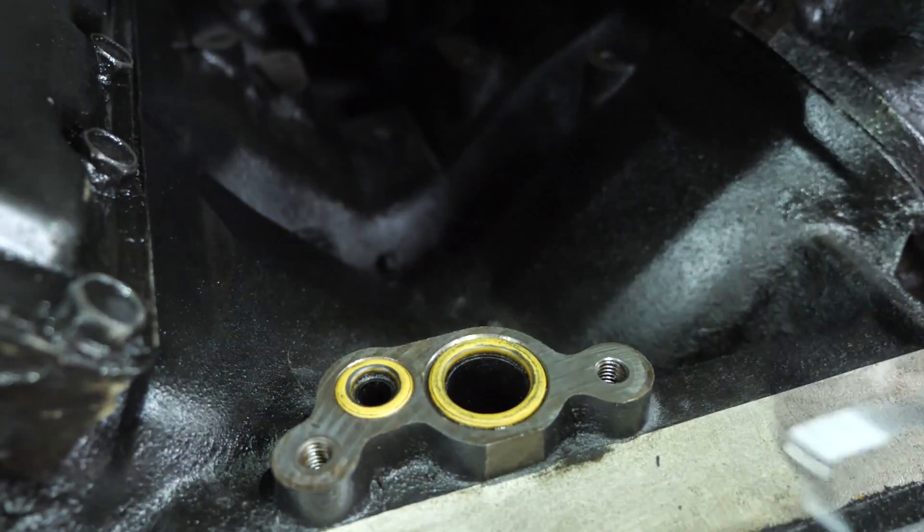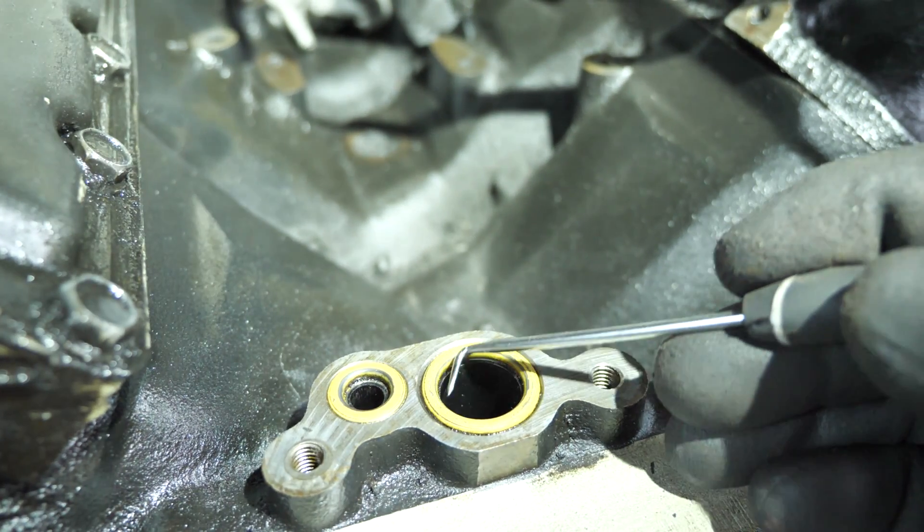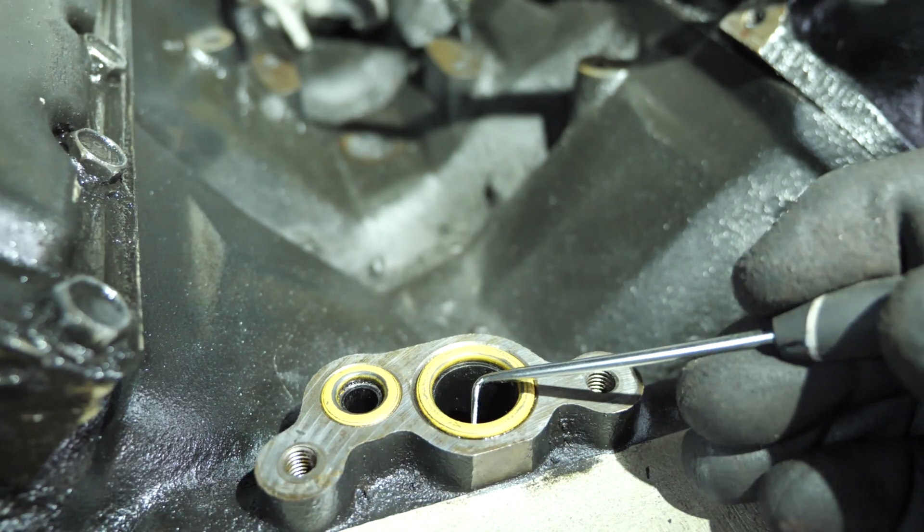When I opened that up there wasn't any giant leaking from the turbo, but I knew the o-rings could be redone. The EPV valve on the pedestal itself, if you guys aren't aware, is kind of a waste control valve — it isn't a wastegate necessarily, but it does control a kind of open butterfly valve on the exit of the exhaust port to the turbo.